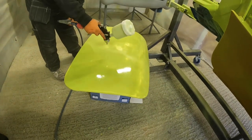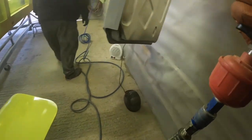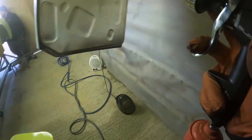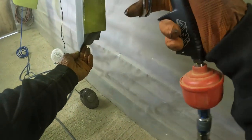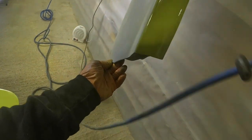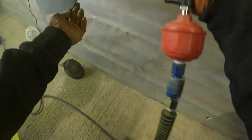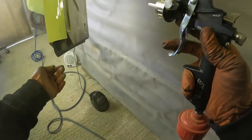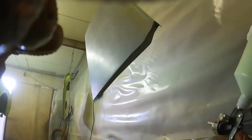But moving on to that second door now, door number two. And as with the first one, going around the edges wasn't too bad. So obviously they're small areas, fairly narrow. So a couple of passes of the gun, it gets the paint down looking pretty good. It's when I move around to the front of the door, you can really see the trouble I'm having. So it looks like the technique I'm using is really odd and completely unnatural. And normally you'd smash over that door, no problem, in one coat without stopping, you're not doing 50% overlap.